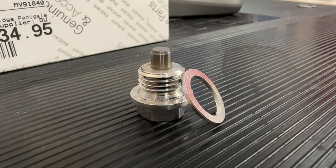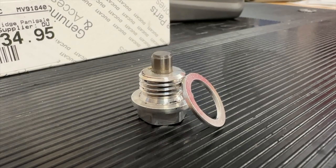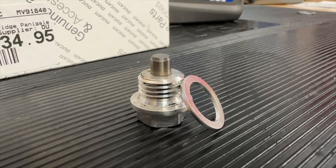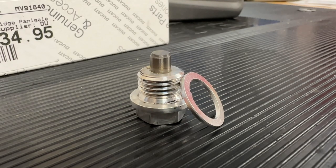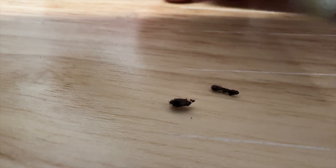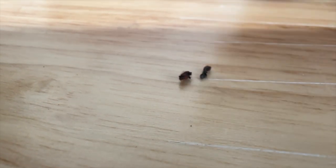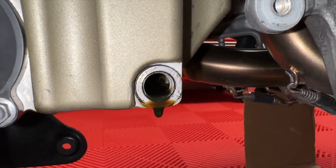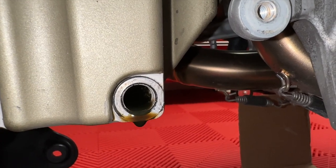Something a little odd with this one — there's a little bit of blackness in there still. I've never had this happen before. It's almost like there was rubber that had melted around all inside the threads and at the base there. This is it all cleaned up. I'm going to put that new crush washer on, but there was a lot of rubbery substance — very rubbery. This is what I pulled out around the drain plug. Not sure exactly what it is. This is why it's nice to have the engine warm — you're going to get everything coming out.